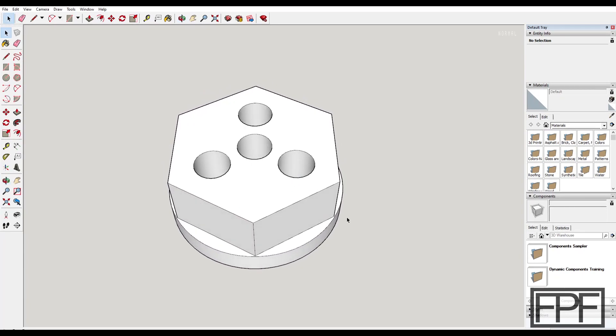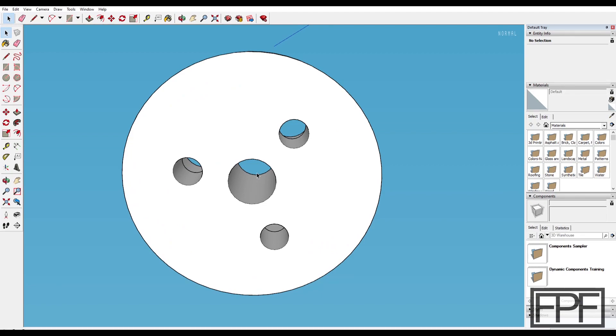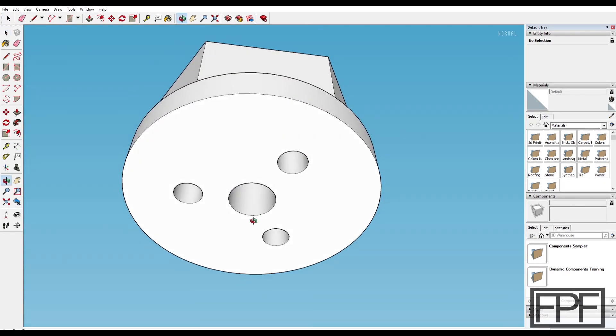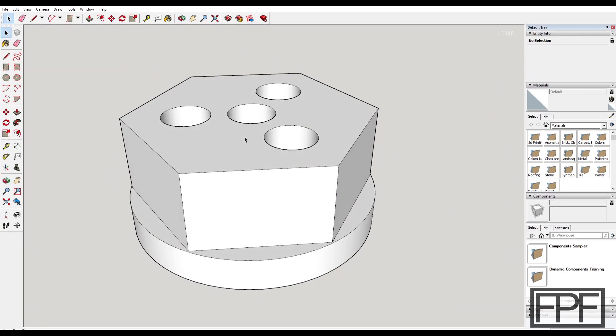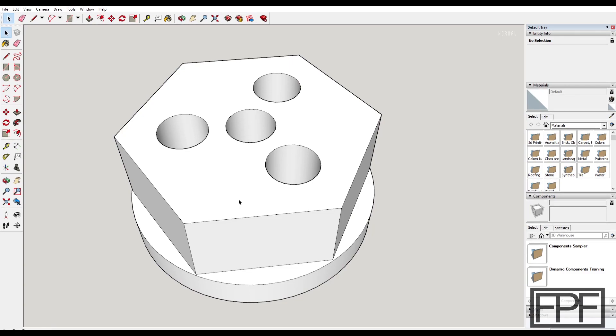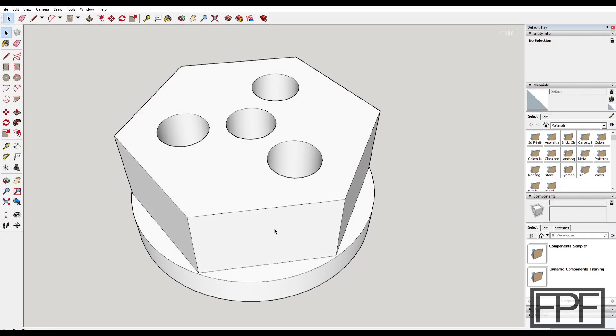Here's the design. On one side, we have essentially just a flat face with the hole spacing to line up with the gaps in that clutch, and the center is just larger than the outside diameter of the output shaft on the chainsaw to keep things lined up — you'd have to pull that bearing off to slip this on. On this side, we have recesses for the larger heads of the machine screws and wrench flats for using a socket to spin this off. I designed this for a 38mm socket and measured the inside of the socket first — they tend to vary between brands. So if you want a nice tight fit, measure the actual socket you're planning to use and undersize that just a bit. In plastic, if you're putting pressure on the corners rather than the flat faces, you're just going to round them over — the plastic doesn't have strength on the corner, but it has a fair amount of strength on the flat faces.